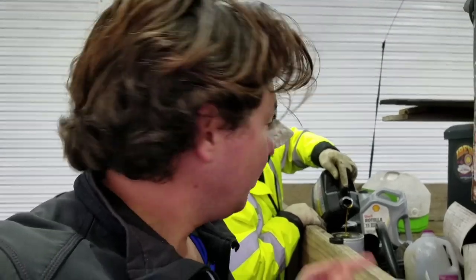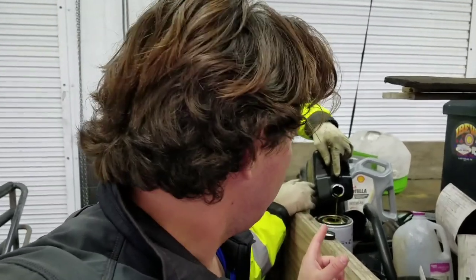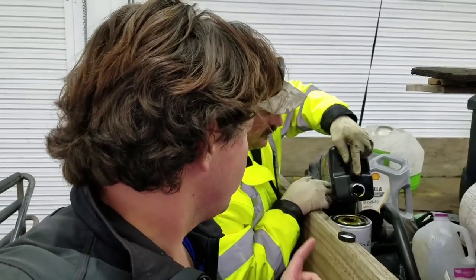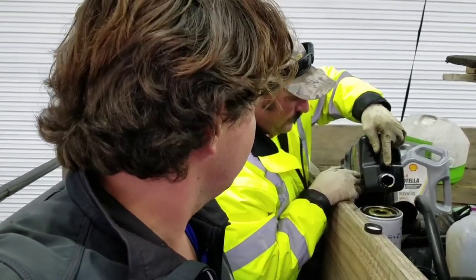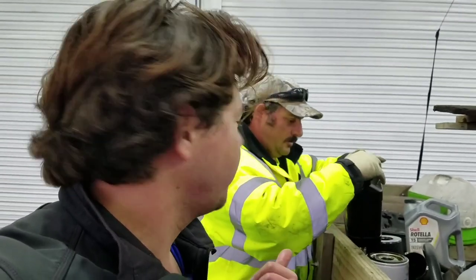You don't have to do all these engine flushes as often, and you don't have to change the oil as often. You also get better gas mileage because the thinner the oil is, it circulates with less parasitic drag. So by actually using a bypass filter, you'll get better gas mileage. Matt brought up a great point: not only does the bypass filter last longer between oil changes, but you also have much cooler coolant temperatures — a noticeable difference. Like an older oil-cooled Porsche engine that held about 10 to 12 quarts, the oil actually cooled the engine. By running this bypass filter setup, it's actually cooling the engine like having a bigger radiator. It's really totally worth it when you're doing 30,000 to 50,000 highway miles like Matt does every year.